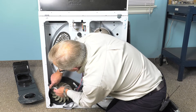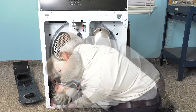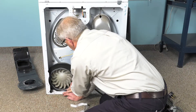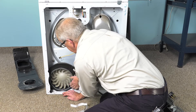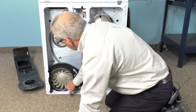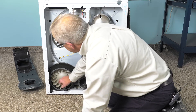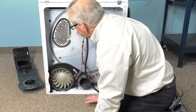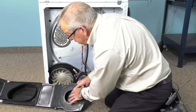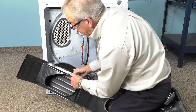Keep it fairly close to the edge of that opening. Make sure that seal is firmly adhered to that surface. While we have that off, it's a good opportunity to clean the excess lint that may be in the blower housing areas. Take your vacuum and then maybe a screwdriver and just scrape each of those individual fins and clean that all out. Once we've done that, we should also take our lint filter housing and loosen up any built-up lint in that area, as well as anywhere inside of that housing, and clean that out as well.